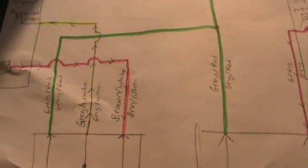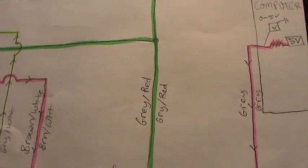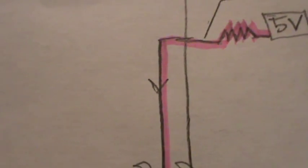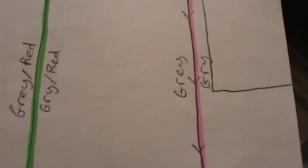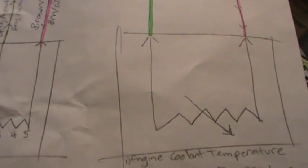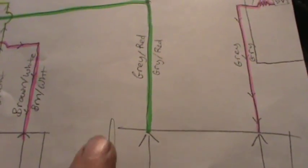I drew a little picture — kind of shows a little bit. Here's the computer. And then you got the voltage sensing circuit, which is right there — you could think of it as being a voltmeter, basically. You've got the five volts, which is sent from the computer through a resistor. Through that resistor it comes down into here. When it comes in here, depending on the coolant temperature or the intake air temperature, that's going to determine how many volts you're going to see right here.